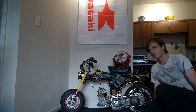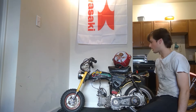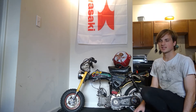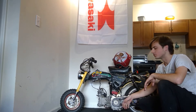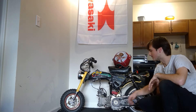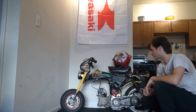I've done some graphics on it and I thought it looked cool. The carb is the most bizarre setup I've ever seen but I got it to work. This thing makes like 12 horsepower — it'll get you going fast enough, it's pretty terrifying. I'm going to cut these foot pegs down because they're just zip tied on right now, and move them down about 2 inches, because otherwise your knees hit the handlebars and it's pretty uncomfortable to ride.